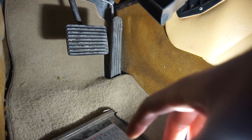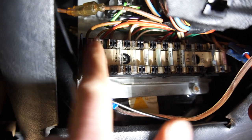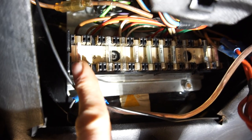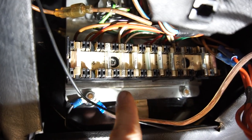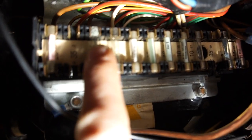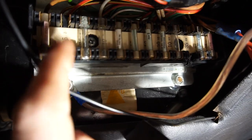I'm definitely going to be replacing that fuse, so you've got to look carefully at everything — you never know what you're going to find. Looking at a lot of these fuses, they look original. Sometimes you can see a little bit of burning on the paper, and that means that fuse has got hot at some point and will probably fail pretty soon. I'm going to have a look at all of them. Replace most of them with new ones. You can see this one up there — there's definitely oxidation, so that's not making a good connection.